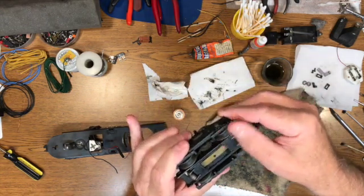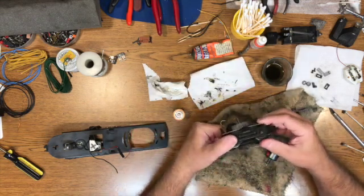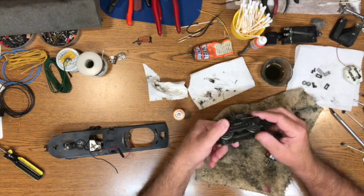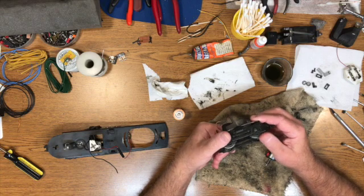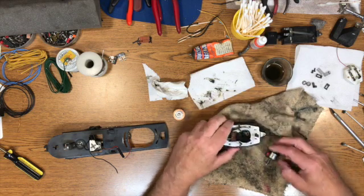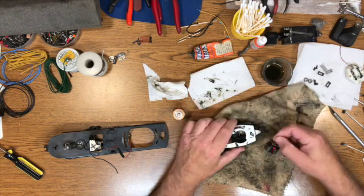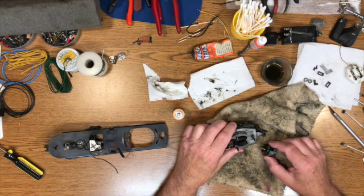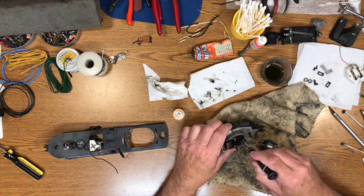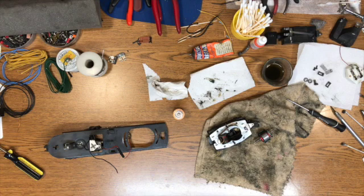the wheels roll fine, the gears work well, and the one gear that's a little cockeyed seems to be falling into place a lot better now that it's all cleaned out and there's no hair behind it. So the next step is going to be let's grease it up. We'll put the armature back in, get some grease and oil on it and so forth, and get ready to put it back together. So what we'll do is get some grease out, put it on the bottom where it belongs on the worm gear, fit it inside where the ball bearing is, and then it's a matter of putting the brush plate and everything back together. Looking down in there, like I said, it looks like a ball bearing. It feels like one. So I think it's ready to go back together.